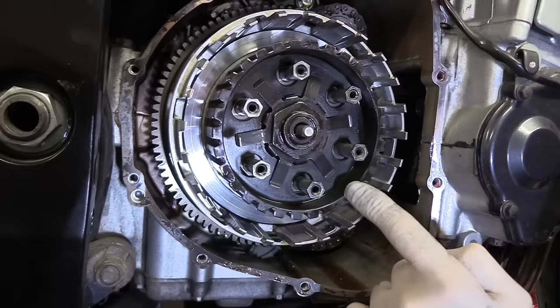And also, just a final word, if you're going to use blue Hylamar, it is a product that never dries. The characteristics of it are that it stays sticky. It remains a sticky blob forever. So if you put too much on the inside there, a big fat sausage of it round, what will happen is when you squeeze that joint shut, as much as it might ooze out and you can wipe it off, remember the stuff that's going to ooze in, where you can't wipe it off. That will then break away and it will drift around in your oil and bung up the oil strainer in the sump and lead to oil starvation.